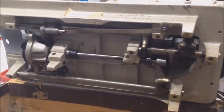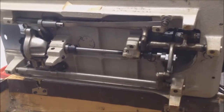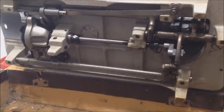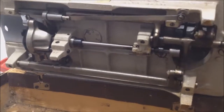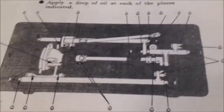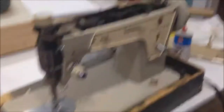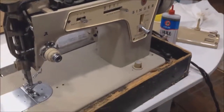When you're powering the unit you can see it's not really rotating — except for the bobbin — that actually goes back and forth. It's just subtle rocking of the machine as it's pulling and pushing on things. So that's the lower end that you need to lubricate with a light oil. They say Singer machine oil, but apply a drop to each place as indicated. There's a lot — anything that moves, kind of type of thing. That's the daily maintenance required for this Singer Fashion Mate unit.